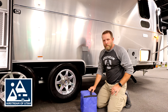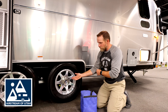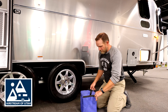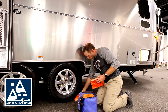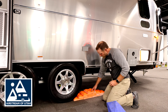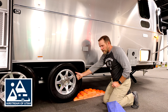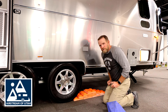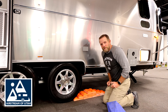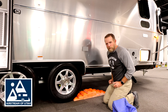Let's talk about alternate methods with a dual axle trailer. Many people drive around with what I like to refer to as Lego blocks in their trailer — they use them under their stabilizing jacks and to level the trailer — but they can also help you in changing your tire with a dual axle. What you would do is build yourself a pyramid. That's a four-inch lift kit. Put this under your tire, pull forward so that the back tire is centered on it, and your back axle on that side will be off the ground. You can change your tire that way, then back right off or pull across. Both are perfectly acceptable.